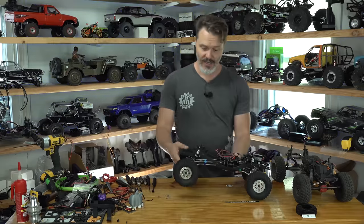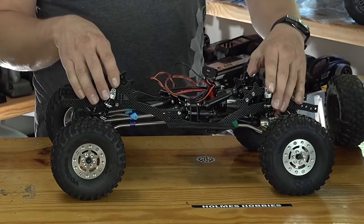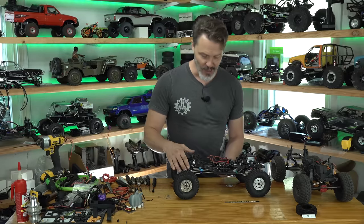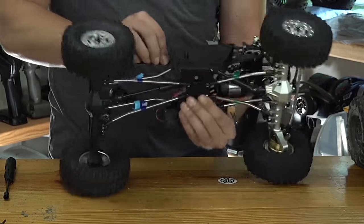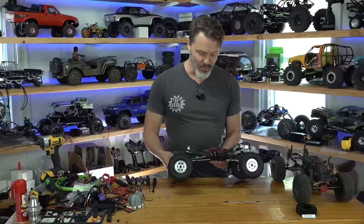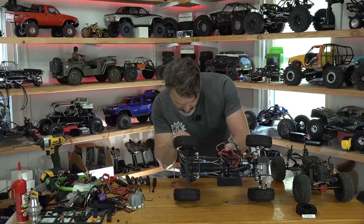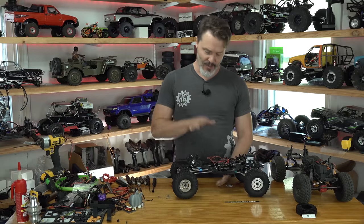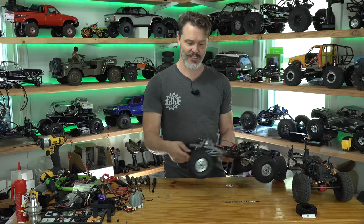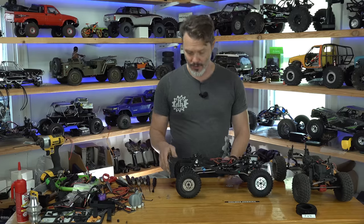That wide lower-link spread lets you tune your roll center better and gives more tuning room for anti-squat as well. On this rig there are no link risers, but we have upper link mounts that we can change — seven different holes to choose from. Going down at the chassis gives more anti-squat; going up gives less. If you did a link riser on the axle end and mounted up more, it gives you more anti-squat — stiffer suspension under load and acceleration. You cannot change the lower link mounts on this axle, so you kind of get what you get there. But we have this option for the upper rear link mounts at the chassis, and that's where the tuning happens.